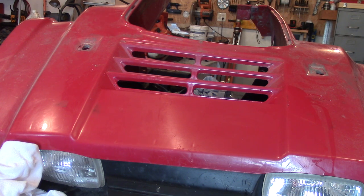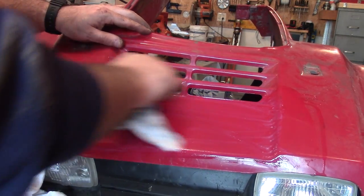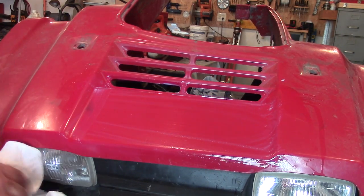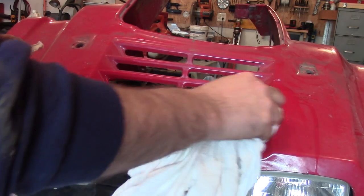So now we're going to apply our second coat — same thing, rub-on poly, water-based. We'll rub it on and take a dry rag and just kind of wipe it off, then let that one dry. You can do as many coats as you want or need.